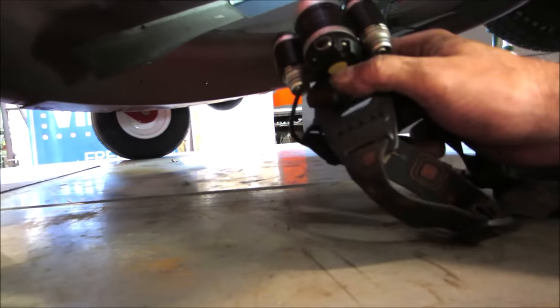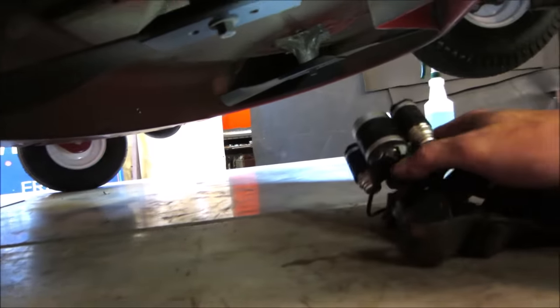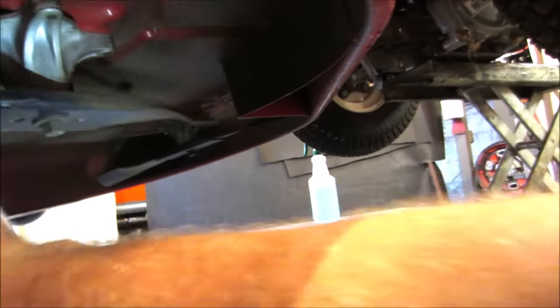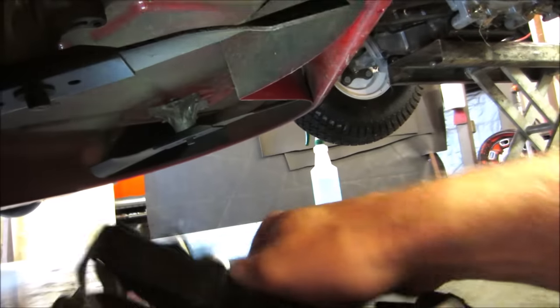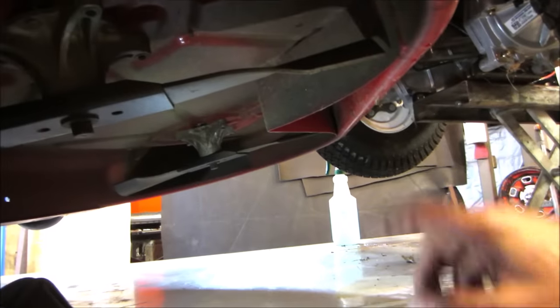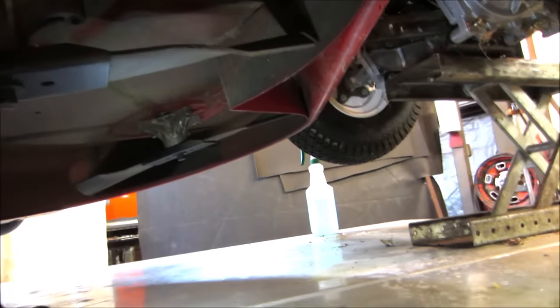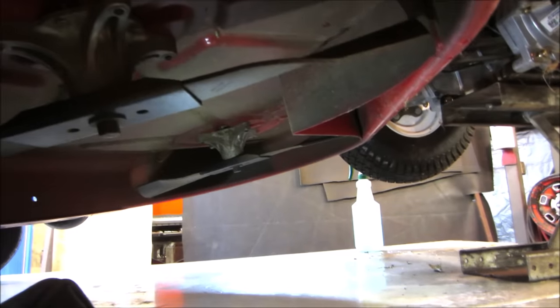All right, let's spin that blade off. We'll flip that one around. I'm just going to eyeball them. I'm going to look at a point right here, spin the blade around, and see if it maintains that distance. I'll do the same on the other side, to make sure there's no bend to them. Those blades are like new, because you're only using the wrong end.